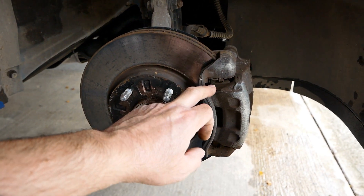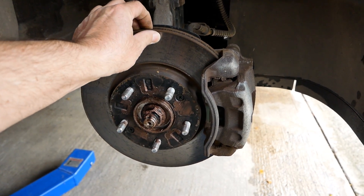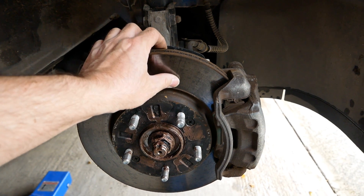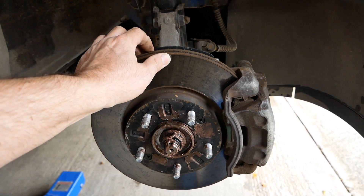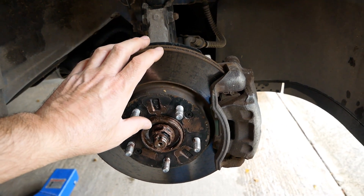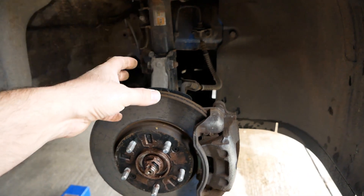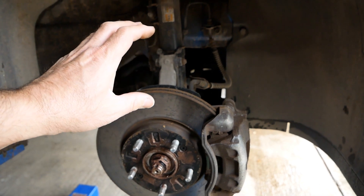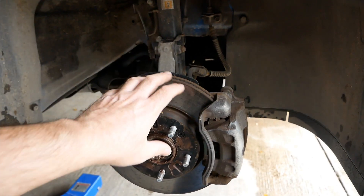If you are applying your brakes you're braking much less and not putting so much force on the pads and disc surface. As a result, on an EV your brake discs will normally be in a poorer state — more rust, corrosion, and scoring. That doesn't actually do any harm; it just means you're not wearing them down as much. If you're driving an EV properly you're doing the majority of your slowing on the electric motor, and if you've got strong or adjustable regen like my Ioniq here with true one-pedal driving, you're hardly ever using the brakes.